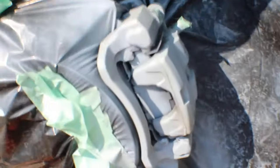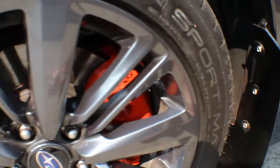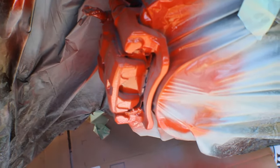I'm going to show you the first layer of primer. As you can see, I barely add any primer — I'm doing small layers so the paint doesn't drip. Just a quick pointer when painting your calipers. There is some redness on the rotor and that's okay — it'll come off once I start braking. Those brake calipers look so nice now. I've got the other side masked off and ready to go as well. After the primer, I added one coat of red. There are some areas that still need coverage but you have to do slight layers or it gets blotchy.